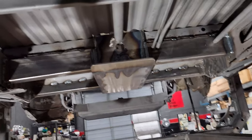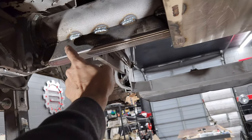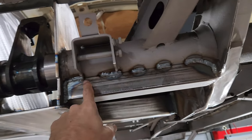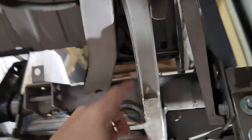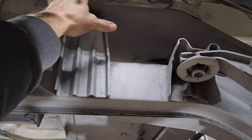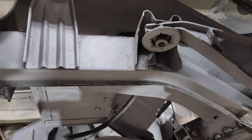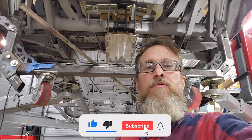I added a two-by-three or one-and-a-half-by-three cross member going across and tying into the frame. I added a two-by-two basically across the bottom of the torsion bars, finished welding up these brackets. I'm not the greatest MIG welder, but I finished up the frame reinforcement there — this is all welded in. I'm contemplating what I need to do over here. I think I'm going to have to notch this up quite a bit — probably has to be above here to clear the axle. Thanks for following along on this project, don't forget to like and subscribe, and we'll see you at the next one. Thanks, peace.